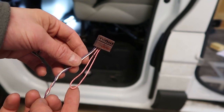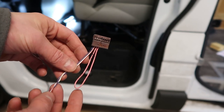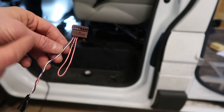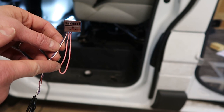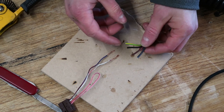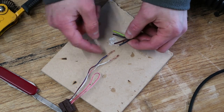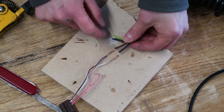If you were to replace the passenger seats with seats or a single seat that didn't have a pre-tensioner, then you would have to short out two contacts on this harness. What I'm going to do is reuse this plug where it attaches to the seat — leave this wire untouched and simply connect these two through the curly wire. There are four cables inside it: an earth one which I won't use, a black one which I won't use, a brown one which I'm going to connect to purple and red from the harness, and a grey one which I'll connect to white and red from the harness.